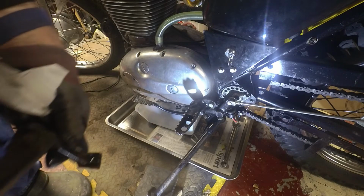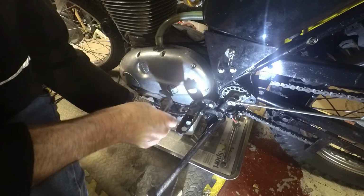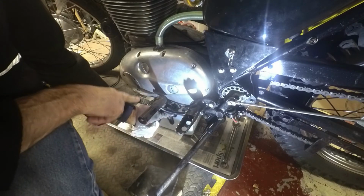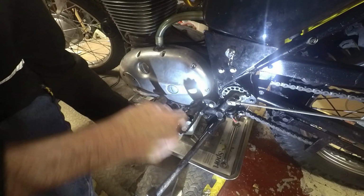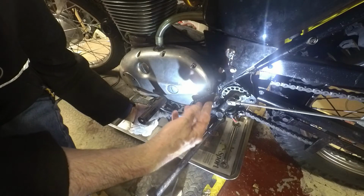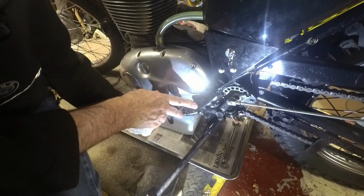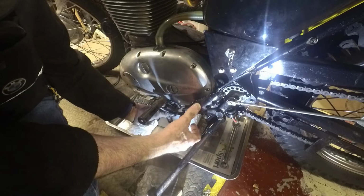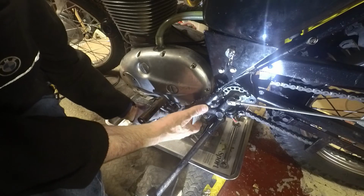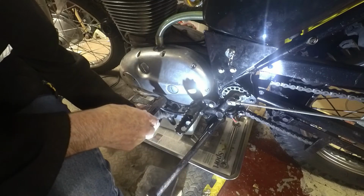Looking at the near side, this left-hand footrest, again, it fits on there and it's fine, but it looks to me as if this brake pedal's been modified as well and been shortened back to this rear mounted footrests. And looking at the brake lever, it looks as if it could well have been cut and welded. So yeah, just here there's a distinct discontinuity in the lever, which I hadn't realised before, but so I suspect that's been shortened.